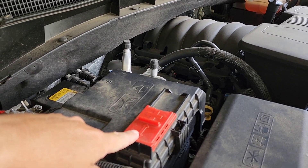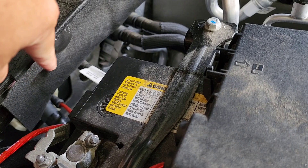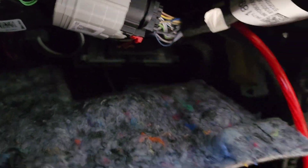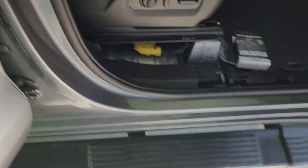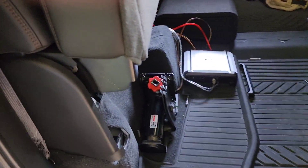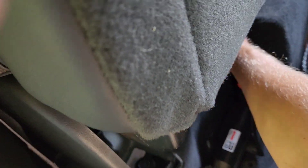Starting up here with the wiring — you can see there's a little grommet down there, you can send the power wire down through the firewall. It goes up underneath and comes through, you can feed it around, pull your trim up, and run the wires through there. Run it through the trim again.